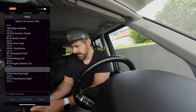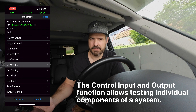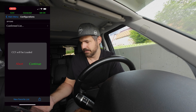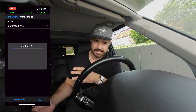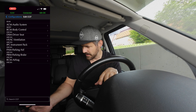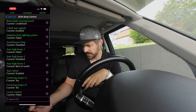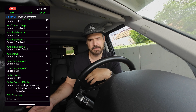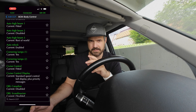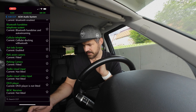There's also a Control I/O section which I've never used, so I'll skip to the next point — the ECU menu. This is where all your ECUs are listed. Going into the body control system, you can see which battery is installed, which high beams are fitted, and here you can activate or deactivate settings. Be careful and don't activate or deactivate things unless you know what effect they'll have on your car.